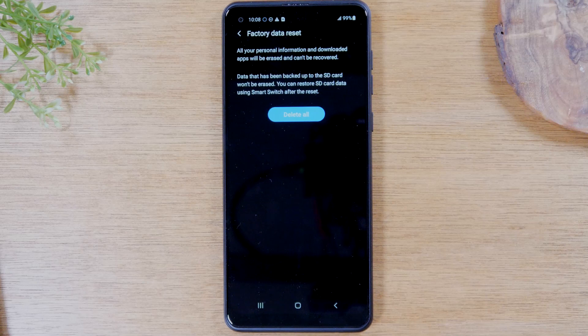At that point, it's going to take anywhere from a minute to about five minutes to erase all of your data off of the phone and then set the phone up like a brand new phone. You will know the factory reset is complete because you will get to a screen that will ask you to select a language.